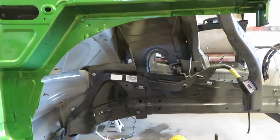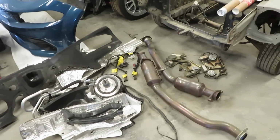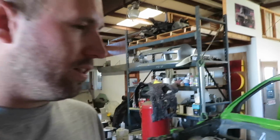since on the Charger there isn't rear AC, and I want to delete the active dampening. So supposedly there is an issue if the active dampening isn't connected. Jose told me that the all-wheel drive won't work. I didn't have the active dampening struts or a module connected to the Durango when I was test driving it, because one of them was broke and the plug was broke, and the all-wheel drive worked perfectly. So I would much rather delete that large computer, because it is quite large.